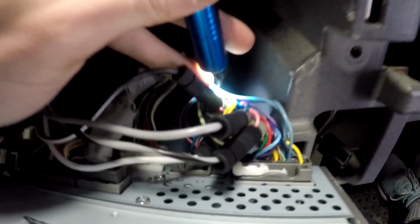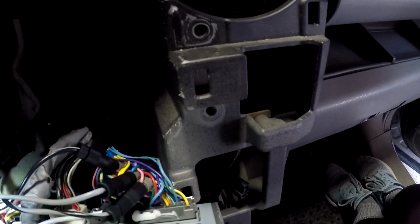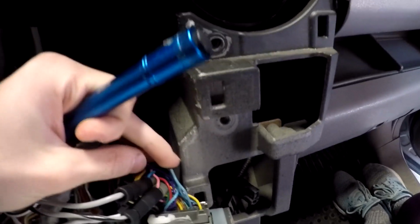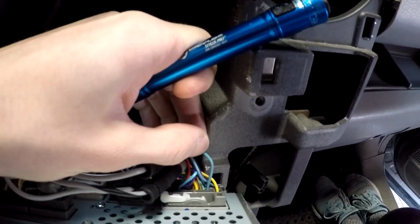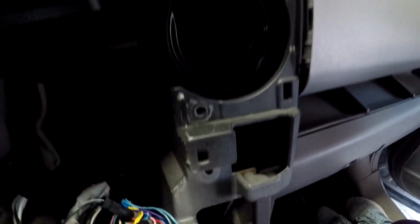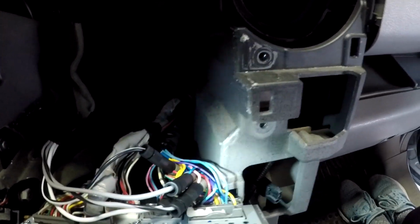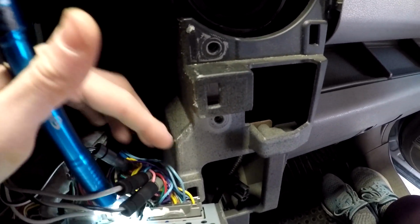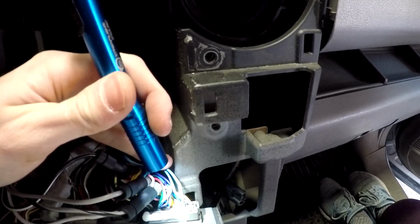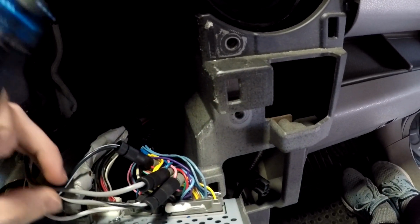The other end has a little pointy end, kind of like a tack, that you put on the cable that you want to tap into. Say you just pulled this one out, right? There are 2 ends to it, so you put the stabby end that looks like a tack into it, and then you screw it down, and basically it'll puncture the rubber or the conduit of the wire and go into it and give you a connection so that you can have signal transferred through there.